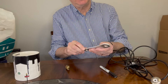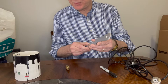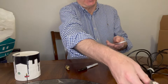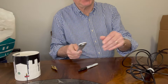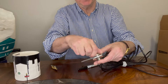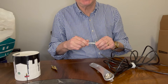This is an antenna mount that hooks underneath the hood of your truck, and the actual antenna mount goes right there in that hole. This was designed for an NMO, which meant the hole was much smaller. I have an SO239 adapter I want to use, so I got a reamer and drilled it out to the right dimensions for the SO239 — a nice snug fit. We'll also need a sharpie, and I'll show you how we use that.